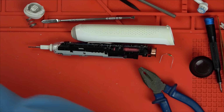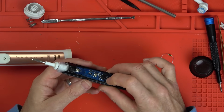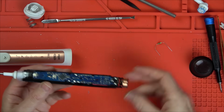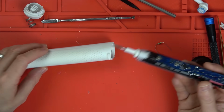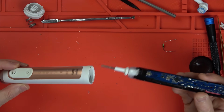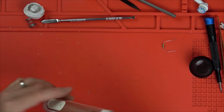How many of these have been saved worldwide because of that? And then loads of people would have done that PP fuse and then been disappointed like me. But because somebody's already taken the time to work out the chip, find the reset, 1K resistor, job done. Amazing. Really is amazing. Right, okay, let's put this back in now.